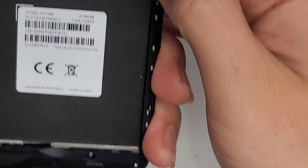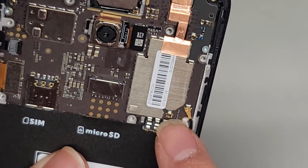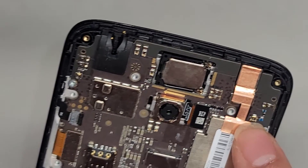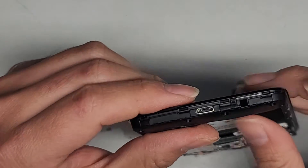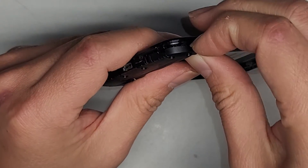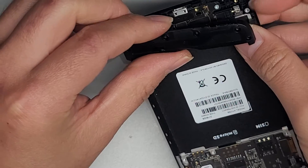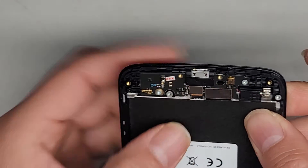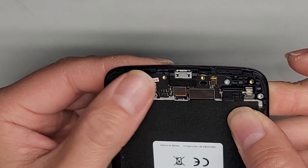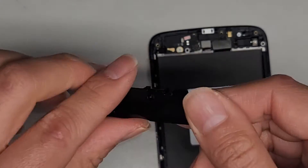So I guess we didn't have to take all those bottom screws out. I don't know if the contact points are bad or something — it doesn't make sense that they wouldn't work. There's an actual other antenna right here. That one is also clicked in just fine. There are these little ports for antennas — one here, one here, one here — but they don't have physical antennas linked to them, so we don't need to do anything with those. Let's pop the bottom one off and see if there's anything under there; sometimes they put antennas in there. I popped that out with my fingernail. Here you can see another antenna right here, and there's a liquid spill detection thing there. There's another contact point here — I think that's another antenna — labeled 'Main DP,' so there's an antenna here as well.